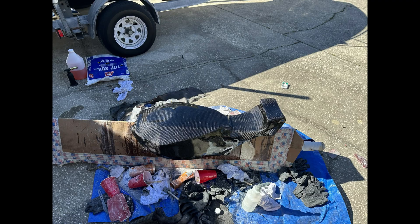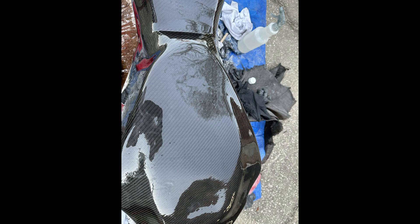I always like to be completely transparent with you guys, and this is why I make these videos. So we had another screw-up. Unfortunately, I put the parts out in the sun — they looked beautiful, awesome — and then we had a cold night here in Florida where the temperature dropped like 25 degrees in an hour, and we got what almost looks like contamination, little divots in the last coat of resin. You can see there's like little divots, little dimples — not what you want. You'd rather have a peak than a valley because peaks are easy to sand and smooth and valleys are not. Luckily we layered enough resin to where we were able to just do a quick once-over sand. It makes it even smoother and prettier, like wet sanding between paint and clear coat.